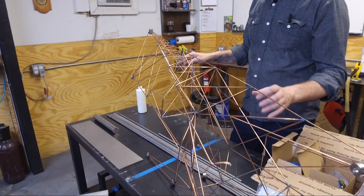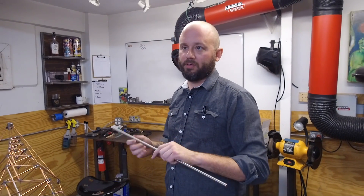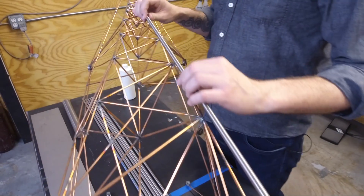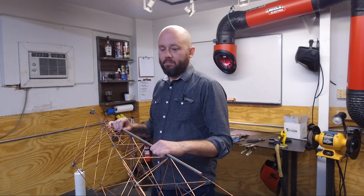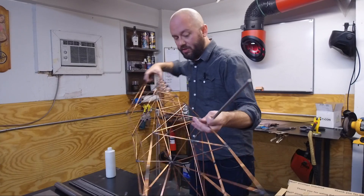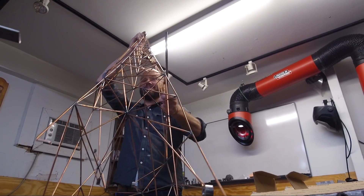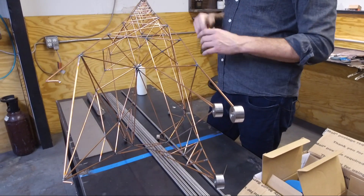Taking that rod underneath the wire fixture — 3/8 titanium. This is not mild steel, it's titanium. It's solid 3/8-inch titanium. It's quite thick but thin when you think about it from a frame perspective. The entire design of this bike is that the engine's asymmetrical, the drivetrain's asymmetrical, and we're building this entirely asymmetrical frame. It looks crooked because it is — it's built to pull all the strength to the right side of the frame where the drivetrain actually is, where the driveshaft and the rear differential is.